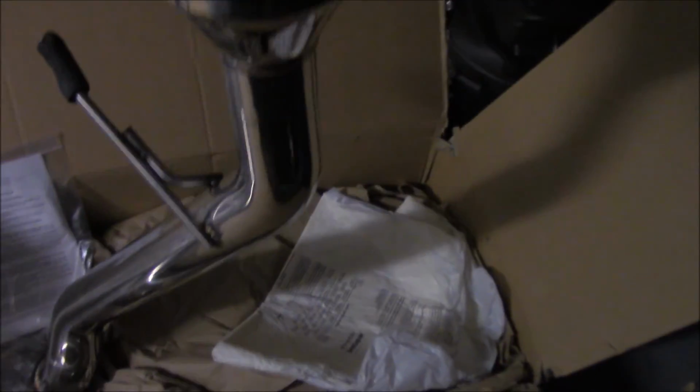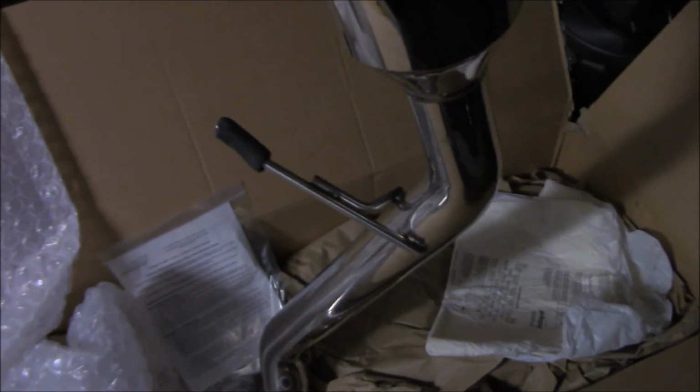And then we move to the back part of this system. A little bit longer. Down there, 3-bolt flange. That's going to connect up to the mid pipe, and as you can see, all of the proper exhaust hangers are on here. Now, I did notice I had to get under the car. That exhaust hanger, you have to flip the rubber bushing to the other side of the subframe, and there is already a point there for that part of the subframe, so that's where that's going to connect up to, and then your factory exhaust hanger on the right side of the car right here, and then the DC Sports logo right on the exhaust tip right there, and a nice slant tip 4-inch tip right there, which does have the option to hook up the DC Sports right there.